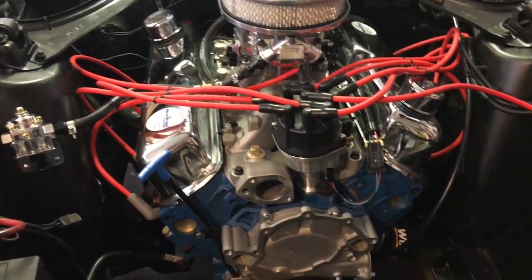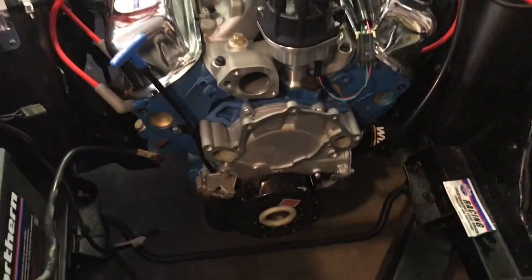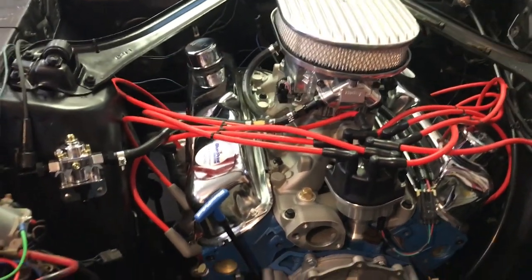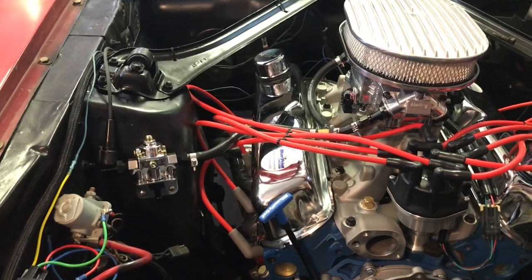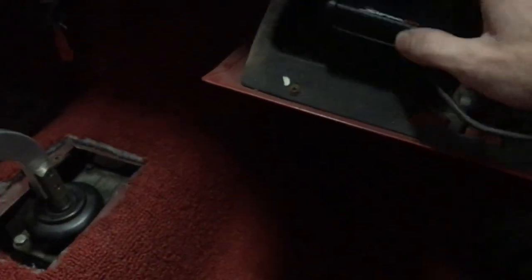The 67 is looking pretty sharp — I've got it really close to being done. We're not done, but firing up. I got the distributor all set, timing all set. The weird thing on these old cars is they're not really wired like a modern car. There was no cranking signal and no 12 volts hot when the key is on and while cranking. You need both of those for the ignition box to stay on, otherwise you get no spark. I had to add a wire and a relay. I've got the wizard all programmed with the parameters for this motor. I just have to finish the fuel system and she'll be ready for her first fire up.